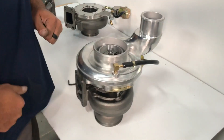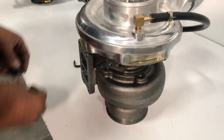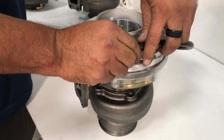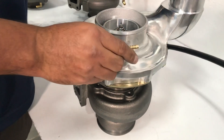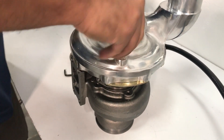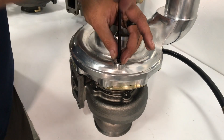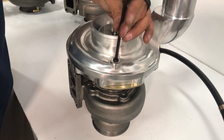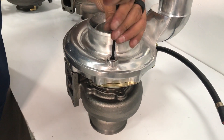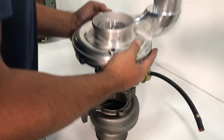So you take your old turbo, you're going to undo the C-clamps out the back of the exhaust housing, your wastegate hose — you're going to remove that — and then undo or remove that nozzle because we're going to have to plug this. Once that's done, you're going to lift it up and out — careful with the fins.